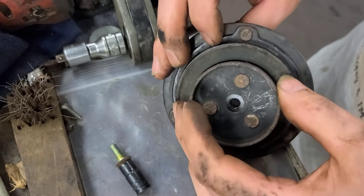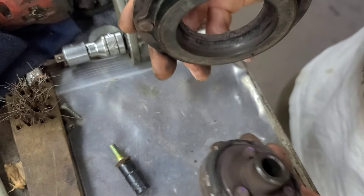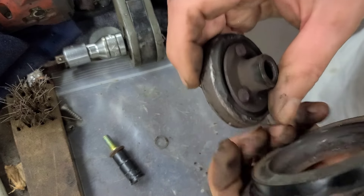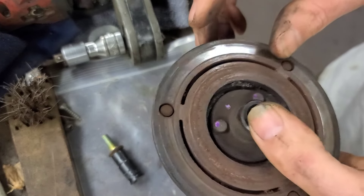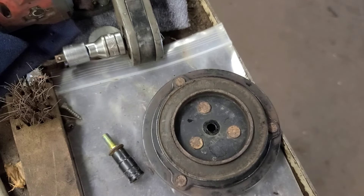This bonded rubber piece has been spinning, so it just needs this drive plate. If we could buy just the drive plate — chances are you can't. There's a selective washer in there that establishes the air gap. This thing is hardly worn; it's very unusual for this to fail. I also realize now that this is R1234YF and I'm not set up to do that, but if we're just going to change this drive plate and reestablish the air gap, we should be good. The compressor turns nice and smooth.